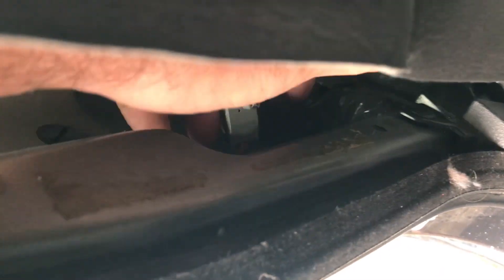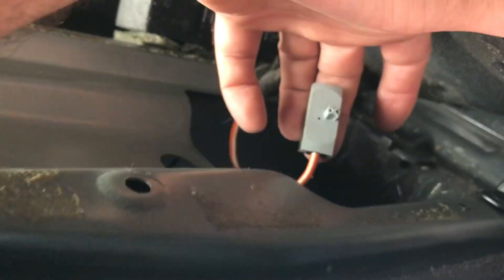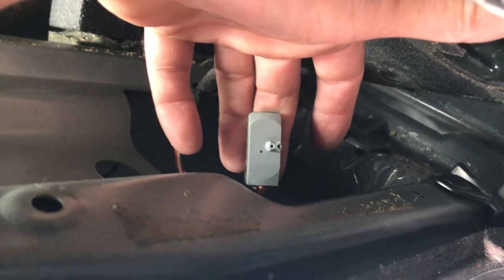There's another — I think a 14mm socket. Disconnect your airbag first, unclip the airbag point. You want to take the negative battery terminal off before doing this on your car. Then take out the belt.